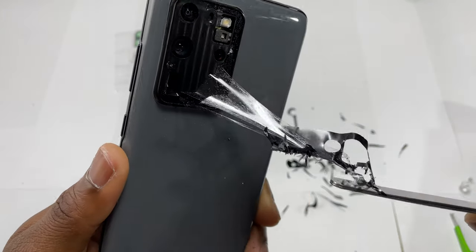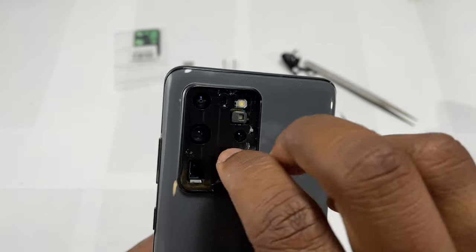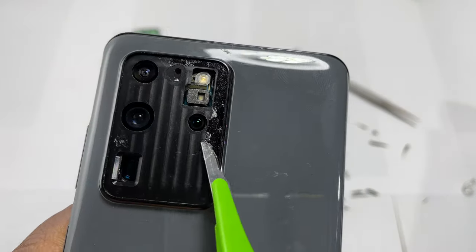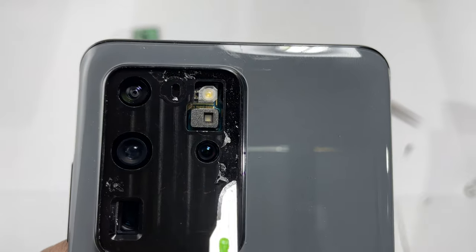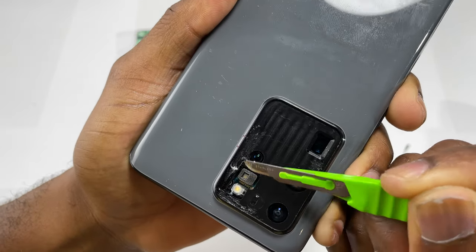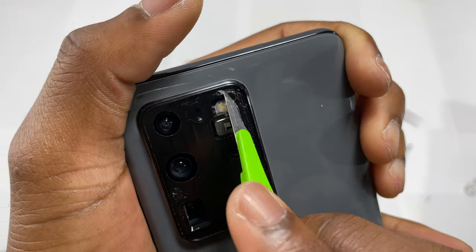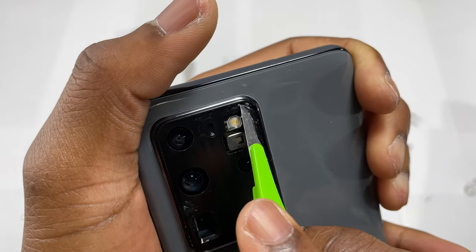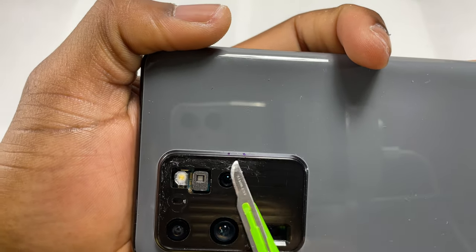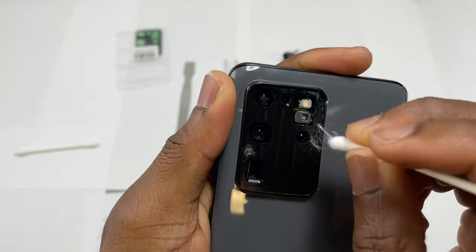So that's the cleaning part of this video. For the cleaning, you can use your sharp blade to remove the remaining tape. This is really sticky so you might have to spend something like five minutes to clean this up. Another way to get rid of all the tape at once is to point the heat gun at the cameras while using your tweezers to pull the tape out of the back cover.